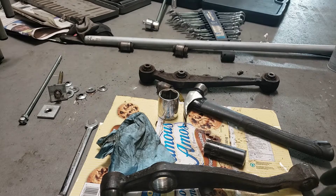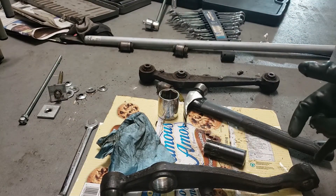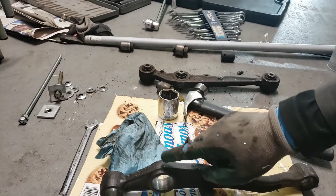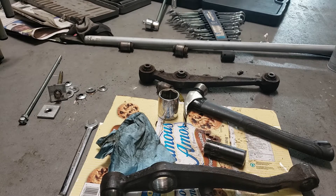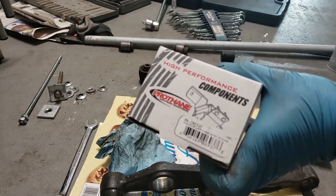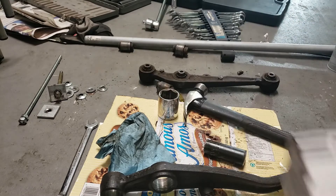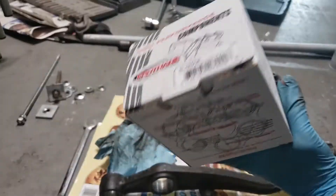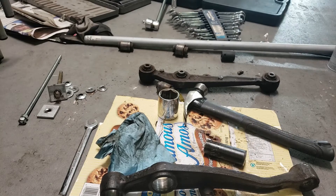With the bushing kit, you actually need two kinds of bushings. The kit usually comes with one set for these outer bushings and then a separate set for this middle bushing - I think it's called the strut bushing. The lower control arm ones fill in the two far corners, and then the rear shock one fills in the middle. You'd replace those if you're also going to replace your strut bushings.